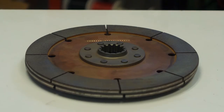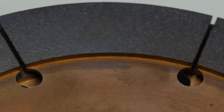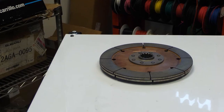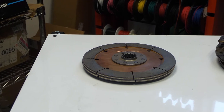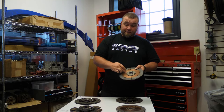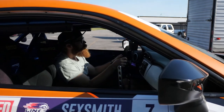The last step in clutches would be a twin disc setup. This is the twin disc we use in our 2JZ STI — the replacement discs are 100% sintered iron, just like the previous one. You'll notice it has no springs whatsoever. So when you pull away from the pits or a traffic light, this thing chatters like hell because the pressure plate grips it and there are no springs to absorb anything — the hub is attached directly to the clutch surface, making it very jerky.